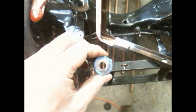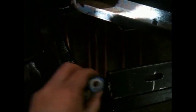I know this is going to look really stupid, but what I did was I just took ten washers, put some tape around them, and I'm going to slide that into the end of this tubing right here over to the slot, so that when I tighten this up it won't crush the tube. I should probably use some adhesive between them, but I'm just going to do this temporarily. Three-eighths should be plenty and that's going to fit these slots just fine.